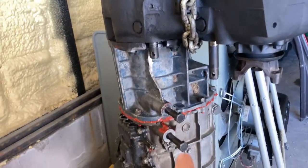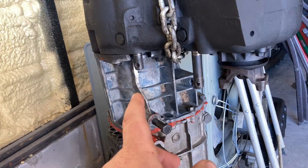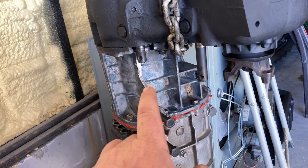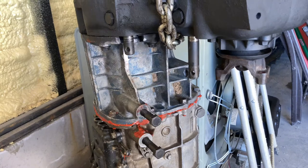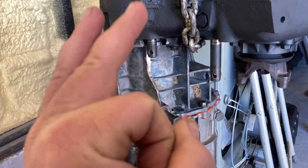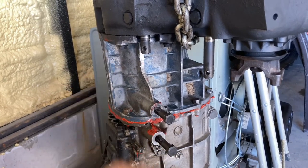What you have to do to get one of these to fit is take that tail housing off — it's just the bolts around it, it comes out. There's a seal in the middle; don't mess that seal up. Take that off and then you've got clearance around the inside of the transmission tail housing. Then there are bolts — they're like Allen bolts — you got to change those with some flatter, small bolt-head bolts, so that way it'll clear.